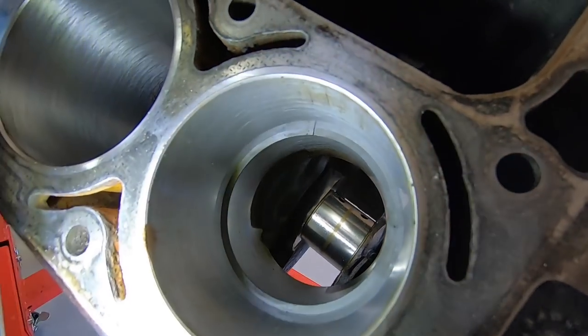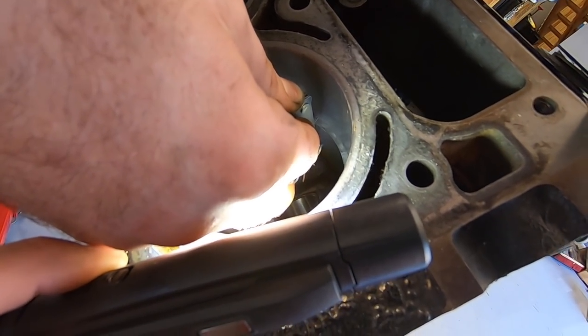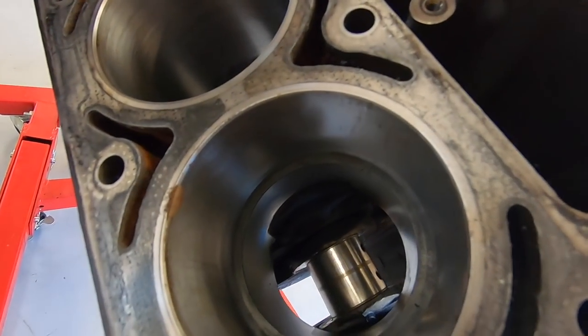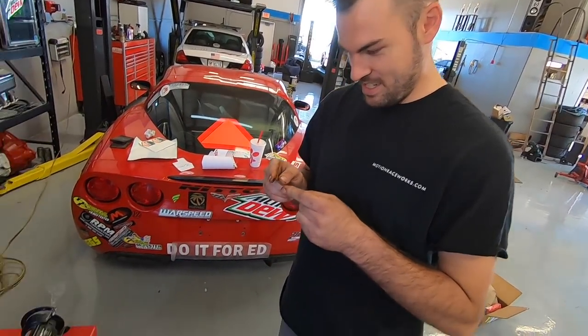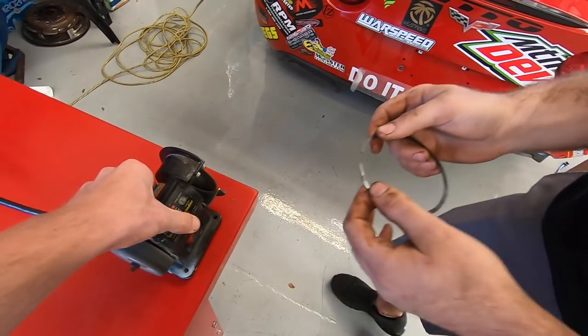So you want to stick the feeler gauge in there, see how we're looking? Test her out. Oh, it's close. Still a little too tight though. Yeah, so probably needs two or three more taps. Yeah, we'll give it a nice solid three tap. Total of seven taps. All right, I'll fire you back up here, brother. Let her eat.